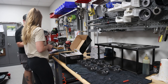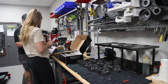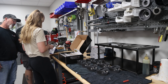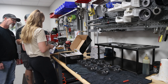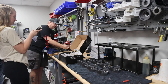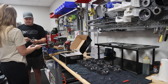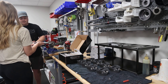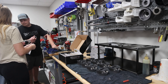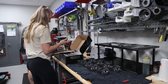You're going to need to make sure you mark the cap and the rod, because when you put it in you only see like half — they only go together one way. You don't want to put your cap on backwards. It's two pieces, so that's why it's important that you mark both sides so they go back together. They're actually already marked from the factory; they have markings on them right here.